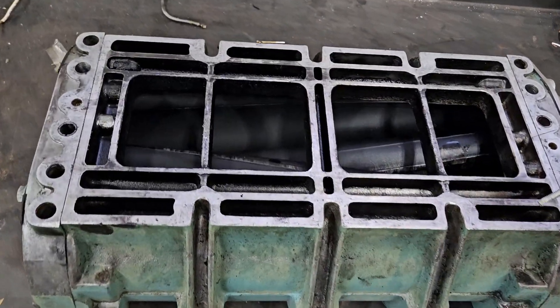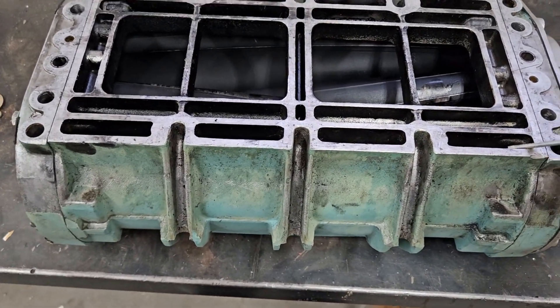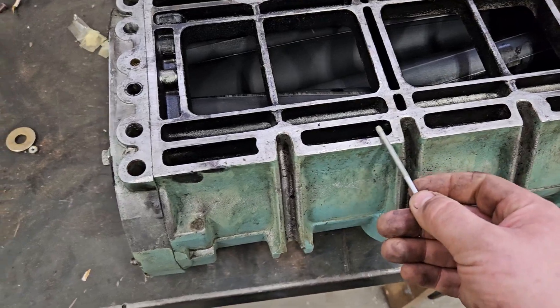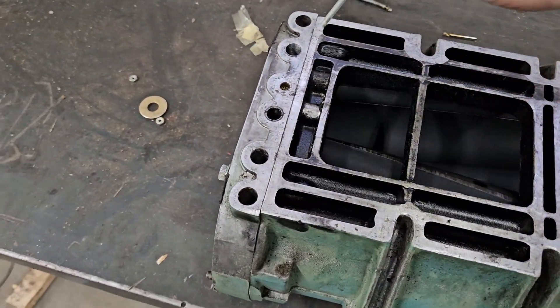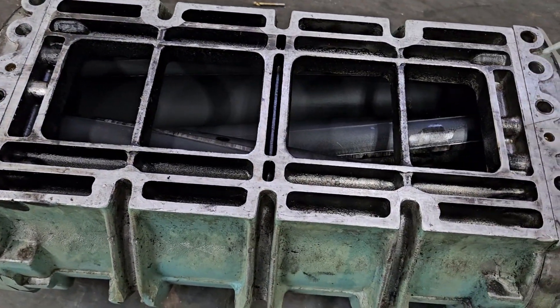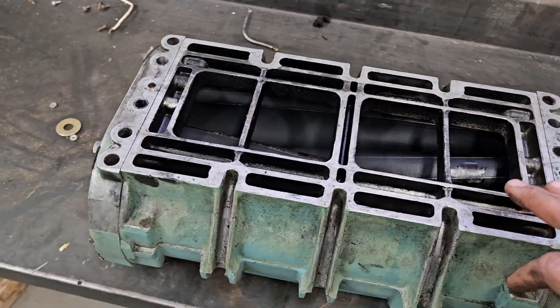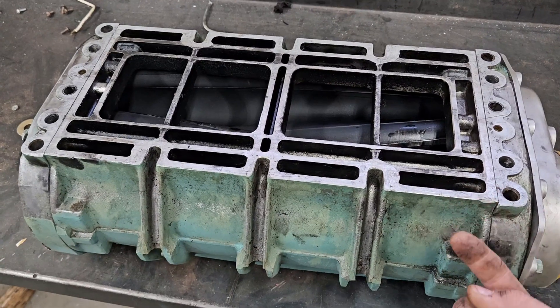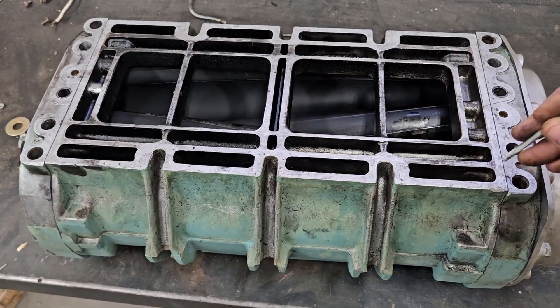Hit the subscribe button — that stuff is super appreciated. So this is the underside. Initially they would bolt in through here at a weird angle, which I don't really like. So I'm going to weld in little bits of aluminum in here, then put two bolts for every section — one here, one there, one there, maybe one in the middle. We'll seal it, and basically our plate is going to overhang a little bit with holes drilled through it all. That's what's going to mount the two of them together. I'll get those tabs cut up and we'll start welding.